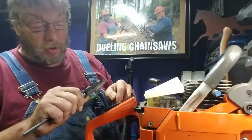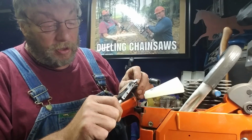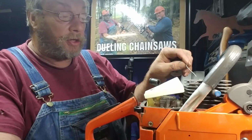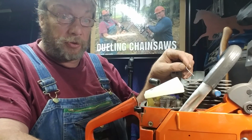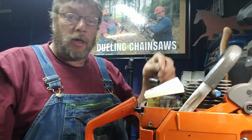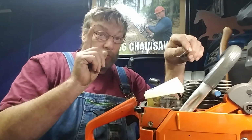Now, instantly I could take a measurement. Okay. That's laying right on 25. But, so that squish on this is 24. It's a good idea to check them front, back, on your quadrants. Sometimes you'll get a cylinder that's machined kind of funny. You just stick it in and you do the curl, and then count it where it's the thinnest, okay?